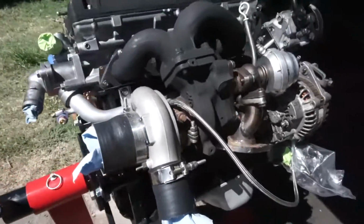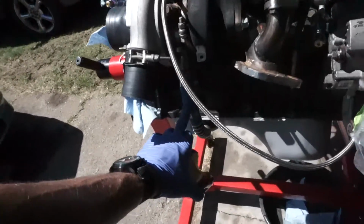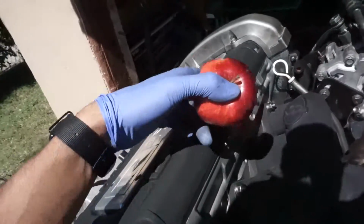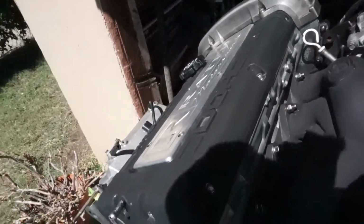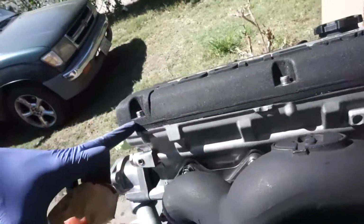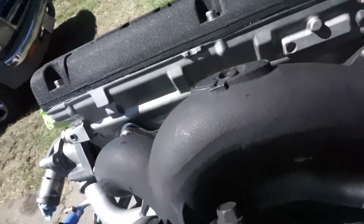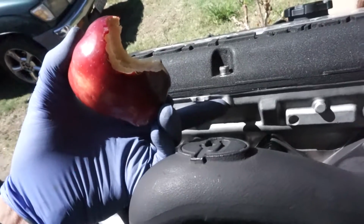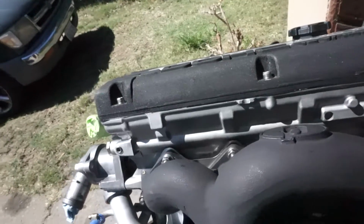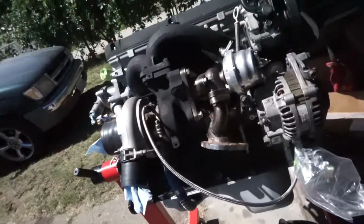Today's the day the engine goes in. So what I didn't record was I just put on the oil return line, and I secured all the fasteners to the valve cover and all the hardware for that. This one's running a 30mm bolt. These are 25mm. Reason being is because 2/3 of these are stripped on the valve cover on the head. So that last third with a slightly taller, or longer bolt, I was able to catch some threads. And with the stainless steel ones, I was able to grip it a little bit better.